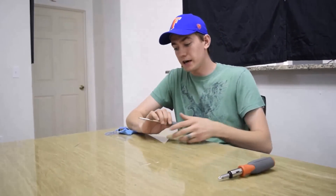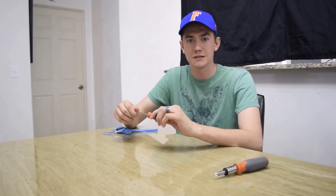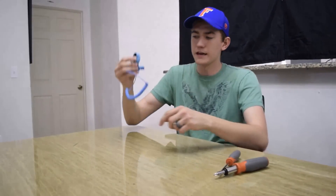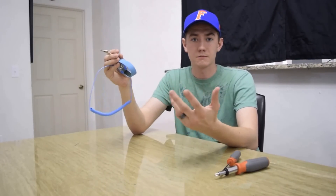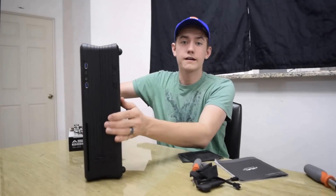For building the case I'm using a standard multi-bit screwdriver for the basic screws. I also have a magnetic screwdriver, because there are parts of this build where you don't have much room due to the smaller case size — I dropped screws a lot during my first build. I also have a wrist strap that grounds me; I'll probably be wearing it around my ankle so it doesn't interfere with my hands.